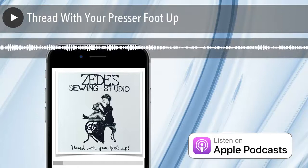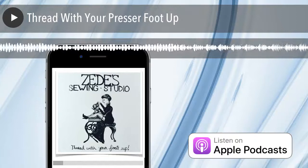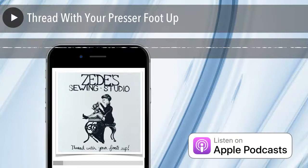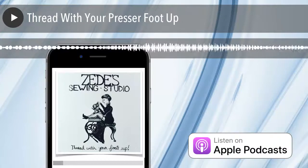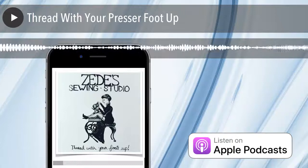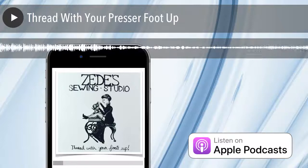That can jam up your bobbin area. If you have a drop-in bobbin you can punch holes in that bobbin case, then you've got loud sounds, shredding thread, starting to bend needles and eventually break needles. So if you have threaded incorrectly, when you re-thread you sometimes need to clean out your bobbin area too. It begins to precipitate a lot of other issues. You can also take an index card and run it through those open tension discs to see if any loose thread comes out — things you can do before you have to call your dealer.